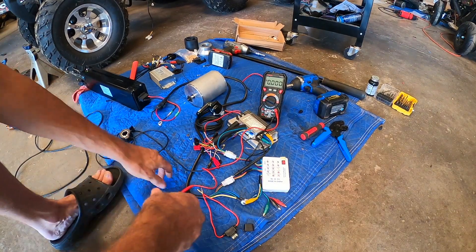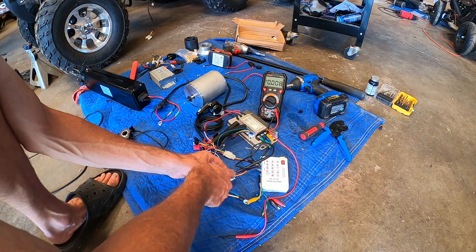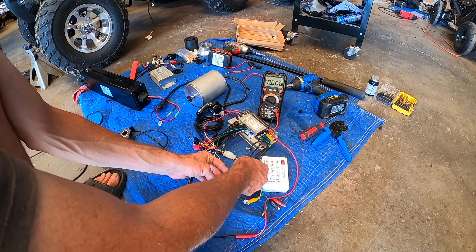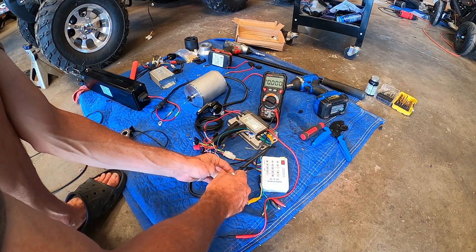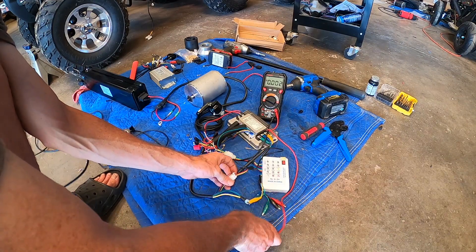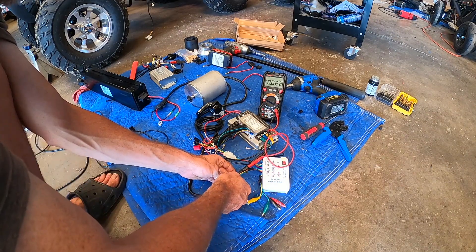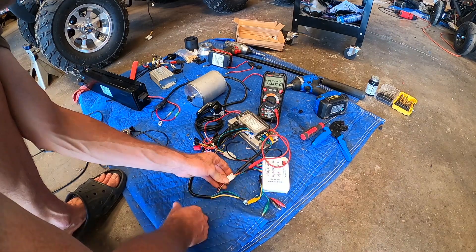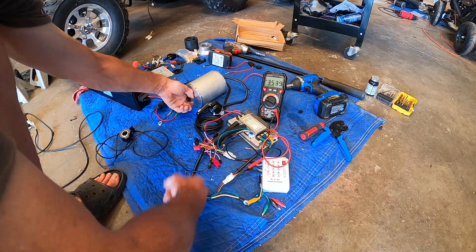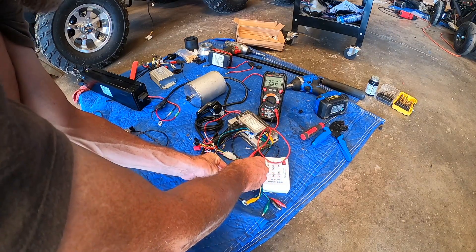Using the multimeter is usually quicker. Pretend this is plugged into the motor and this is the controller. Plug the battery negative probe into the battery negative lead of the hall connector, which is the black wire, then run the positive probe into each of the return lines - the blue, yellow, and green. Turn the motor and you'll see 3.5 volts each time a sensor passes in front of a magnet. Do that with each one.